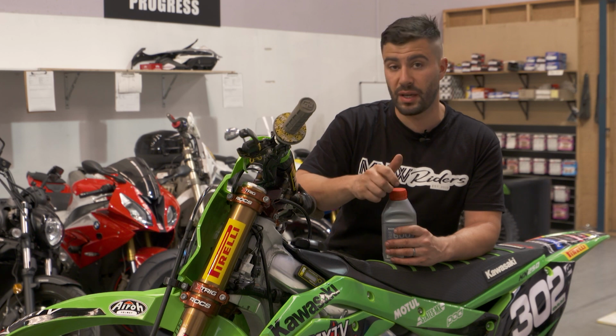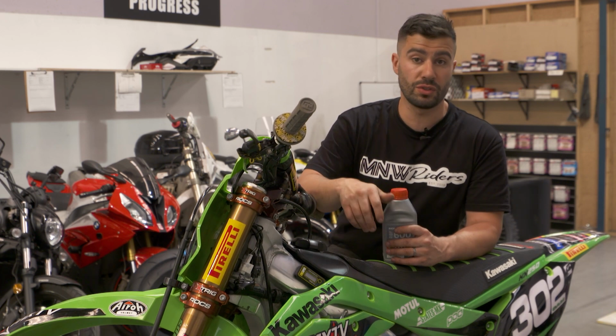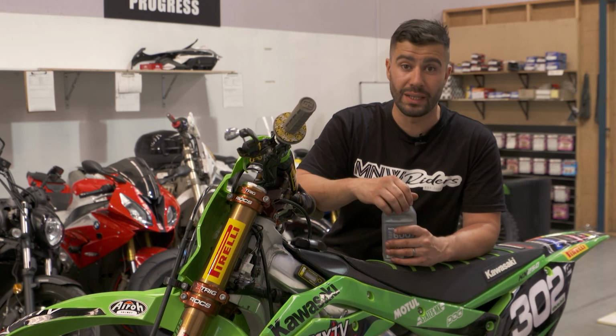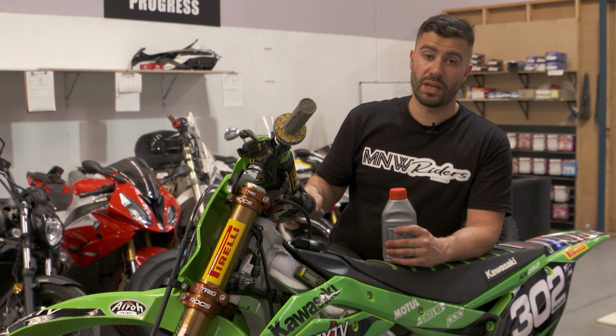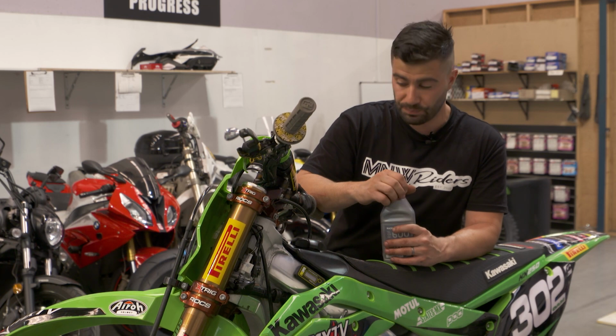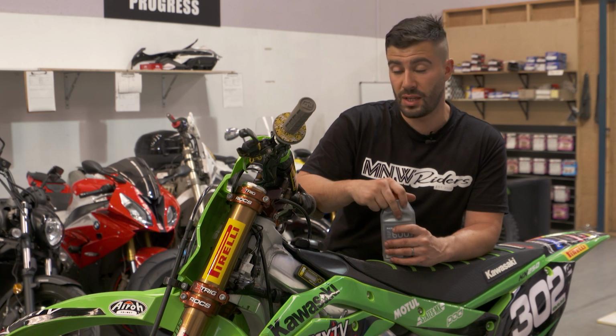You want to make sure that your brake system is serviceable, so your brake pads are in good condition, at least a millimetre, either front or rear. To start with, make sure you've got some firmness. If you don't, you may have damaged seals or a loose line or a faulty banjo bolt. From there, you get into the bleeding.